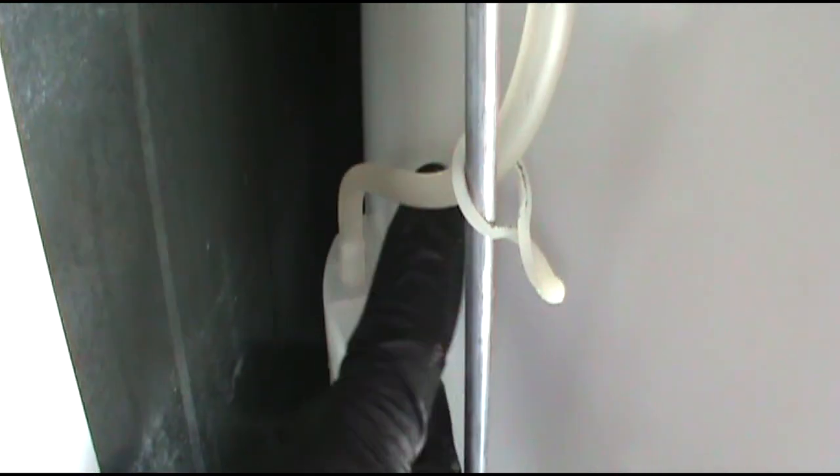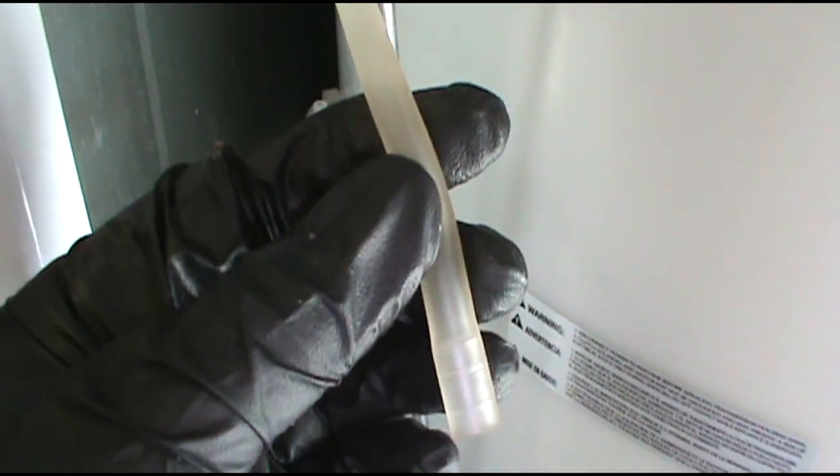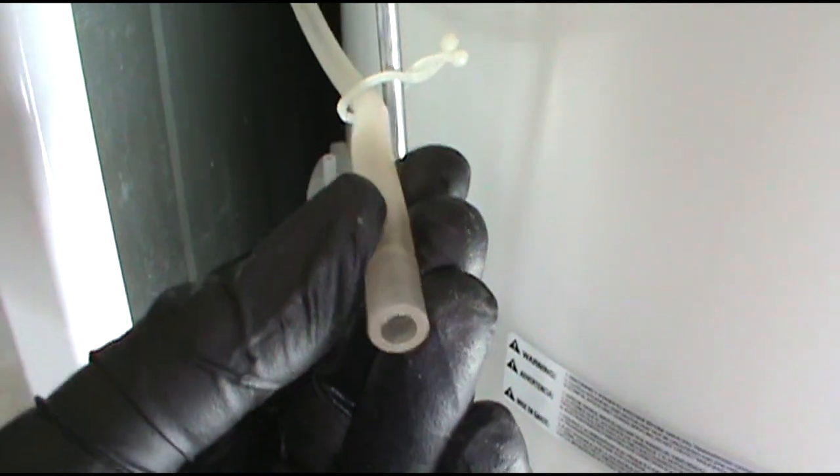See this hose right here? Just pull it off that little nipple there. These things get clogged — make sure you don't have any debris in it. If it's really clogged, your washing machine won't know when to stop filling up and it'll overflow out of the top and all over the floor and cause a flood.